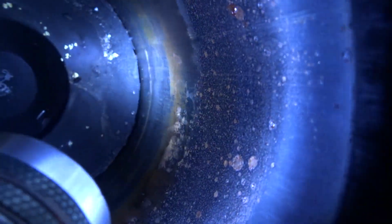This one looks a little crusty. This one looks like it was getting water into the cylinder. You see that? That is not good. Can you see the crosshatches still? Yes, I don't know if you can tell. Wow. Might have got myself a good engine, boys.